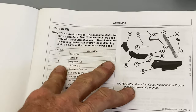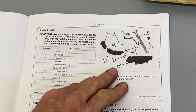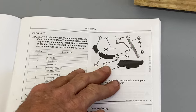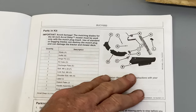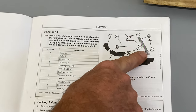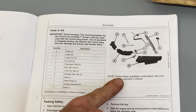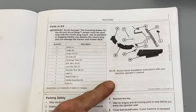The instructions say that if you're going to use this machine to bag or to regular cut, don't use the kit or take the kit out. I think the high-lift blades would beat up the plastic if you were trying to use it for bagging. So just keep in mind: if you're going to use this kit, stick with your mulching blades and you'll be fine. You can easily open up the side discharge if you don't want to mulch, or take the kit off entirely and put high-lift blades on for your bagger attachment.